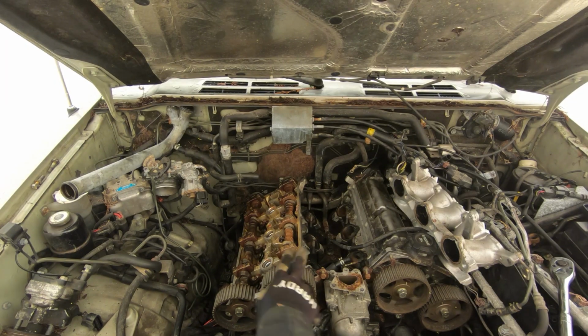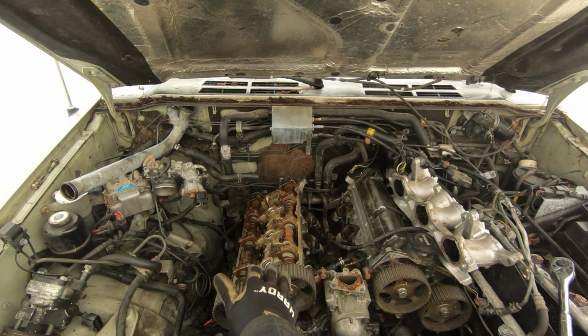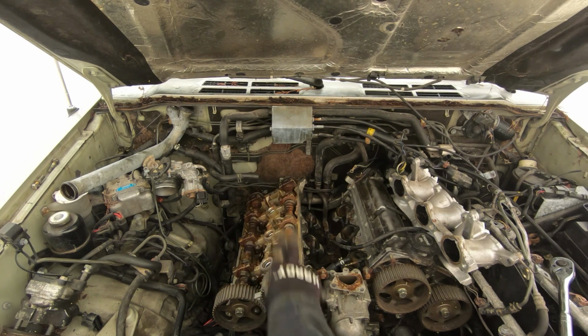Okay, I got them all snug down. Now I'm going to tighten them first to 30 pounds, and then I'm going to tighten them to like 55 pounds, and then do the full 78 to 83 pounds. So I'll just probably go right in the middle, 80 pounds. So 30, 55, 80.